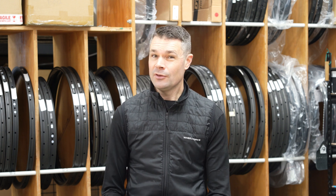I'm on the fence as to whether DT Swiss are heading in the right direction. I think the mountain bike market wants one hub which can do everything by being modular and interchangeable — for customers this is the big selling point of Hope Pro 5, Dial hubs, and One Up's new hubs. DT seem to be heading in the opposite direction by making a different platform for every type of riding. However, the Deg hubs look really well made, the extra engagement points are great, and the ability to easily service and replace bearings is fantastic. The price tag is pretty high and I can't help but think a 350-price version will be really popular. The hub market is becoming increasingly competitive and DT Swiss are just stepping it up with the Deg.